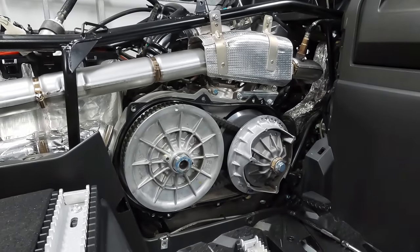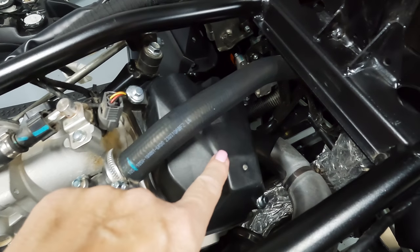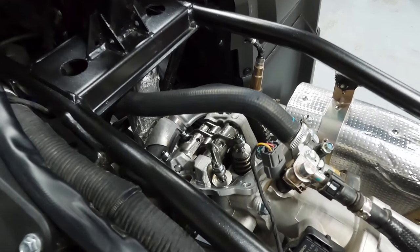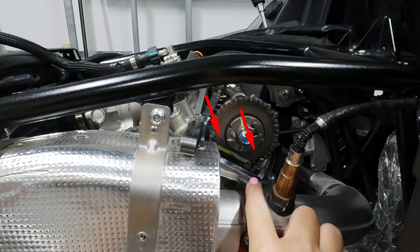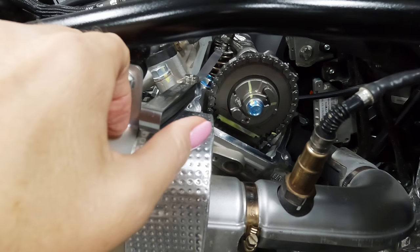The fuel tank is now off. I've taken off the side casing and you can see the clutch assembly. So this is the valve casing — should be able to just take the four bolts off and get this casing out without removing the coolant hose. So finally down to the valves. I have to say this is a lot more complex than I realised — neither myself nor my husband is a mechanic. Put a wrench on the crank so I can turn the engine over to line up those two marks with the cylinder head. When they're lined up it means the engine is at top dead centre, which is what you need for adjusting the valves. There's a feeler gauge on the valve so I can check — it should just have a little bit of pull, but that's fine.